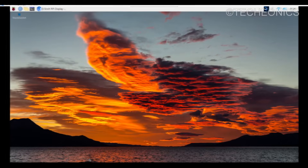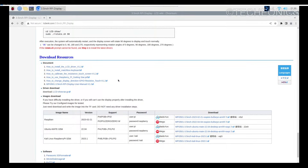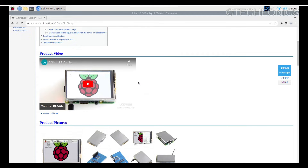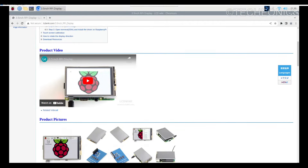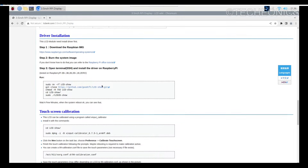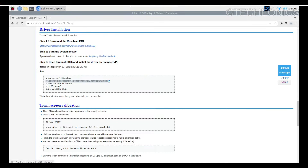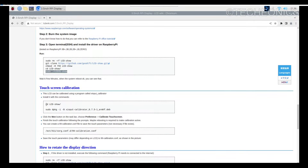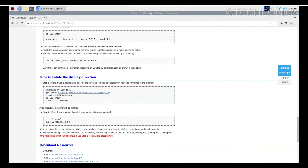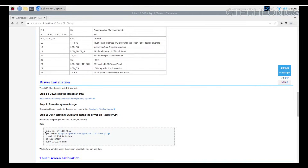After powering the Raspberry Pi, go to this link — the link is as always in the description below. I will also post a full detailed article on my website. Here we have a wiki page for this LCD where you can find all the details. First we need to install the driver for the LCD and then activate it. Here are the commands to download and activate the driver. This command downloads the driver from the GitHub repository and then activates it. If your touch is not working properly, you can use this command to calibrate your touchscreen. If you want to rotate your display after installing, you can use this command to rotate it.